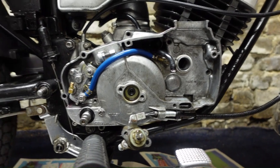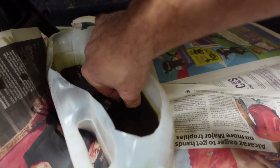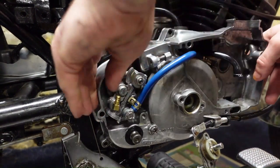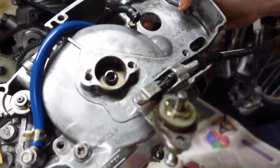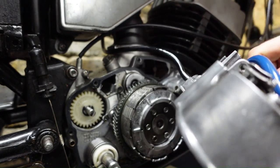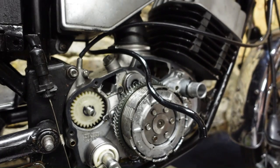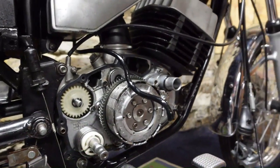Classic error - whatever this is just fell in my oil, so that's not cool. My fingers are full of oil everywhere but that's the life I lead. It looks like this will just pop off - it all comes off in one piece. I just want to pull this petrol pipe through; to do that I need to just remove a little clip, then gently remove it up and out. So now the side casing is there still connected up to the clutch.